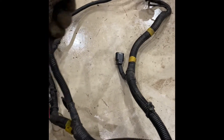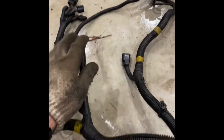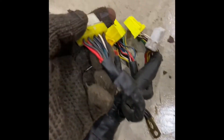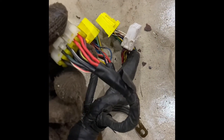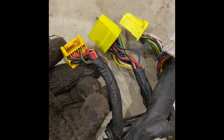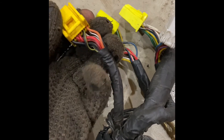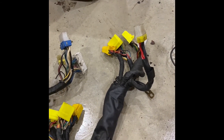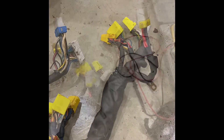The black with red goes straight to a fuse — I think it's a 20-amp fuse. Black with yellow goes to the starter. I think those are the main ones. The only other wire you need to hook up to make the computer power up is a red wire. I'm pretty sure that's in this connector, though I kind of forget to be honest — you'll have to check the diagram to be sure.